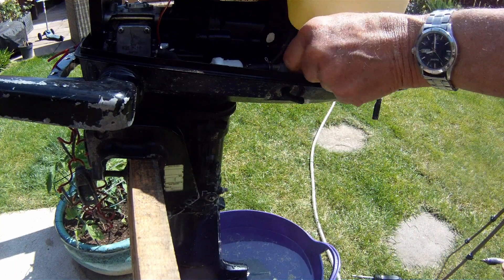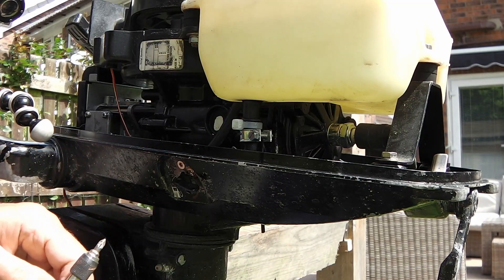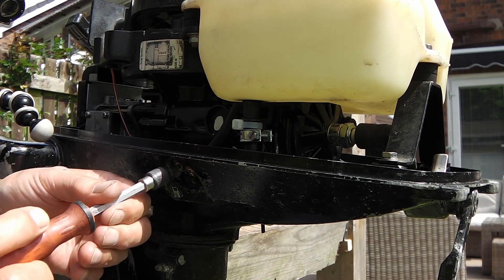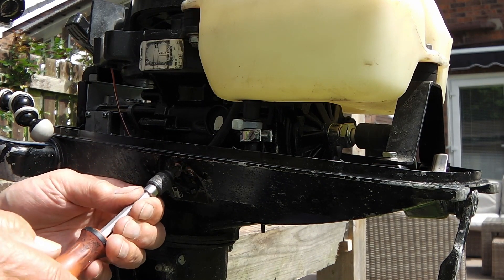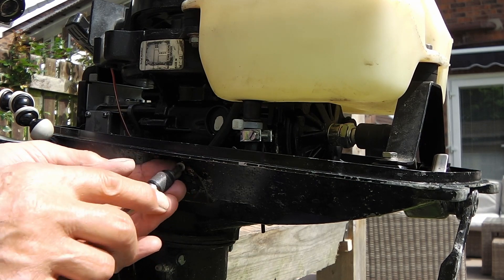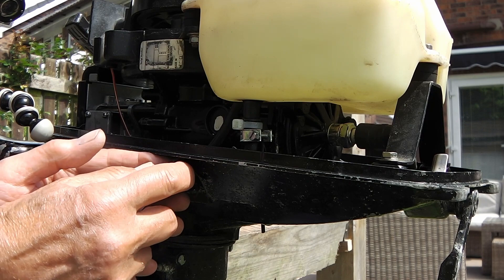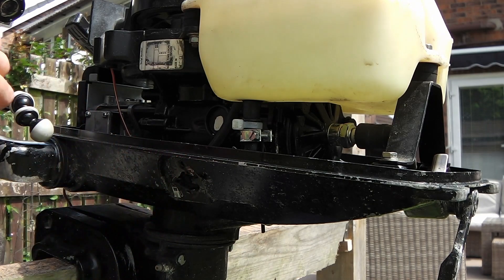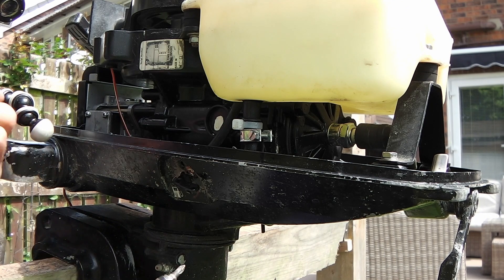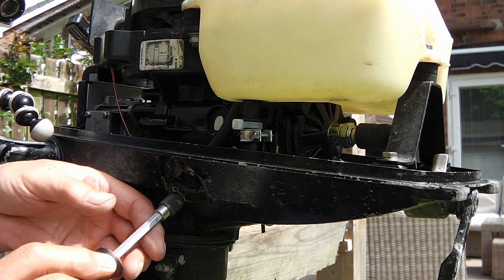Plug the fuel pipe instead of taking off the whole fuel tank, so we just need to get at the shut-off valve. Unfortunately, part of the fuel pipe is torn, so I'm going to have to go and find a little bit of a replacement for that before I can reassemble.